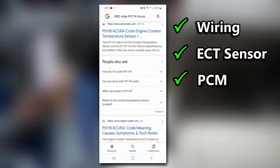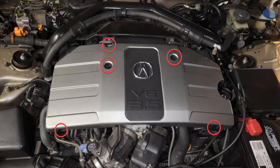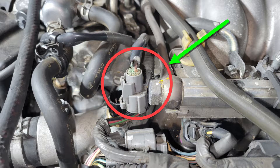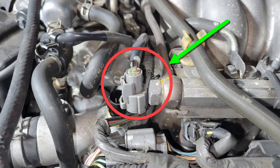We'll delve a little deeper and walk through some troubleshooting steps later, but my issue was rather straightforward as we'll see in a minute. I wanted to physically view the ECT sensor, so I removed the engine cover by undoing the five 10mm nuts and bolts. The sensor is located on the right. The wire broke right at the connector and there's some green corrosion where the wiring enters the connector. To be completely honest, I did miss this the first time around and ended up just replacing the sensor since it wasn't expensive.